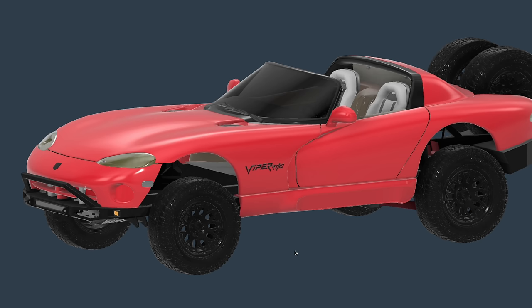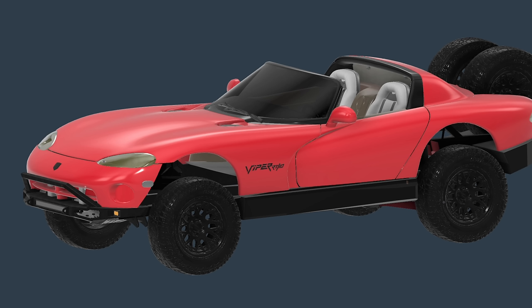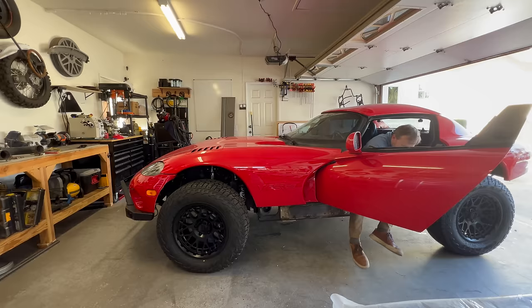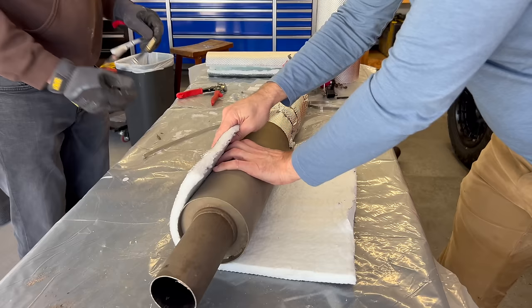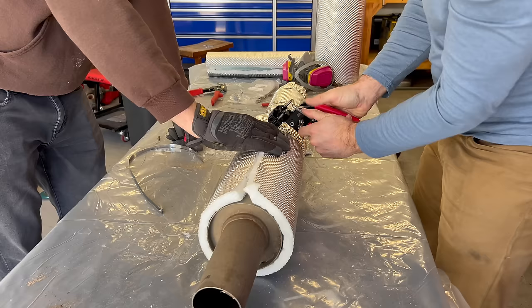I also ditched the original rocker covers because I'm going to make my own using the magic of Send Cut Send. They will be metal and double as rock sliders, and also double as incredibly hot leg-burning devices, unless I mitigate that somehow. So we decided to wrap the cats and mufflers in some fiberglass heat shield, shiny blankets of fiberglass and aluminum to keep the exhaust warm, and the outside not so warm.